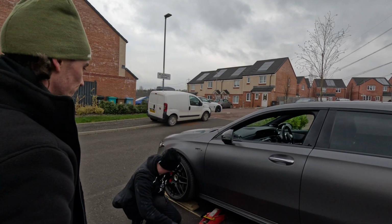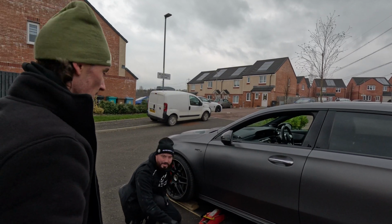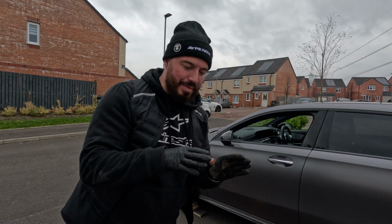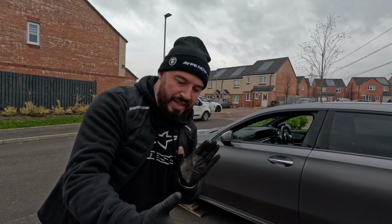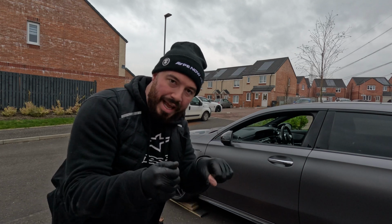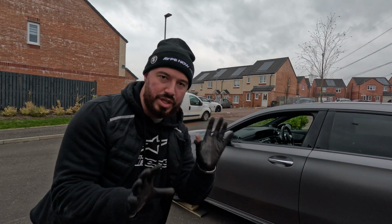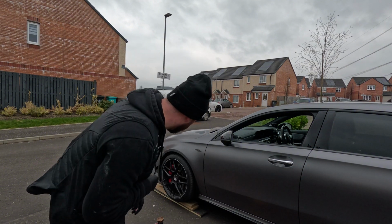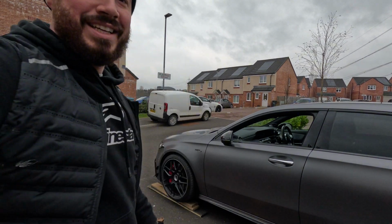Absolutely fine. Spot on, man. I'm glad we got those arch cars now. So we were wrestling with it a wee bit there, but we managed to get to grips, so we think we need to put the spacer on the inside of the wheel first, tap it in with a hammer so it's lined up with the holes, because when you're trying to do it all at one time, it's too much. So we're going to carry on right around the car now, but looking good already.